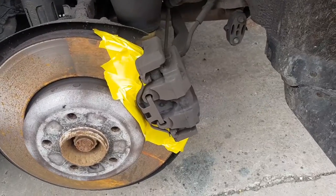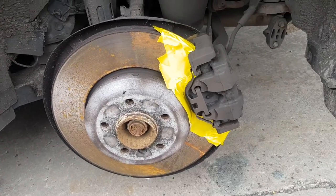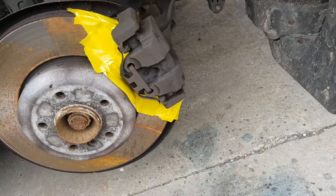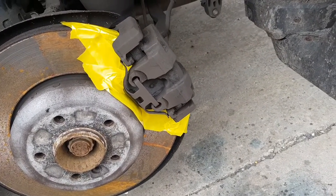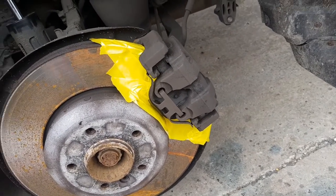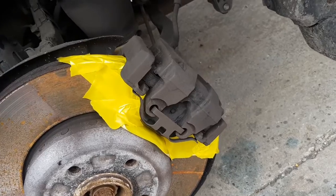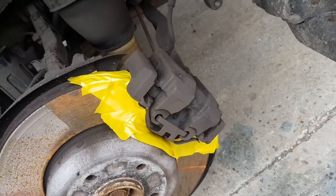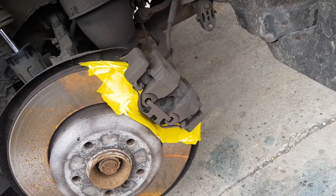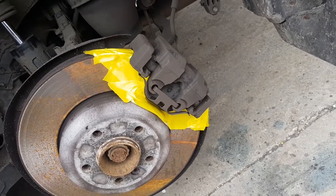With the calipers, all I've done is use a bit of two-pack thinners and a red scotch pad and just worked all the dirt, grease, and rust off, then given it a wipe down. I'm not going to take the brake pads out — I'll just paint them as they are. Whenever the pads are replaced they'll look fine. A lot of people do take the calipers off and get them powder coated, which means taking the seals and pistons out and basically rebuilding them.